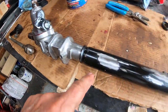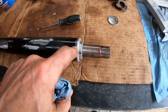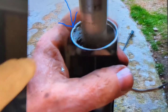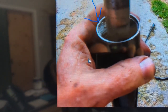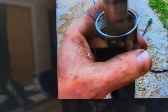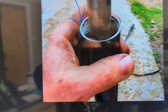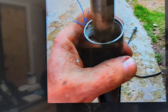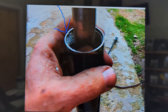Got things epoxied, got things welded. This stupid nut stripped out on me when I put it back on — that was stressful. See that little dent right there? You've got to remove that with a grinder or file because you won't be able to put the aluminum nut back on. I didn't notice that until watching this back. That's the factory way of making a lock nut — they intentionally dent the tube. Nissan does the same thing. Clean out the threads before putting that aluminum nut back on.